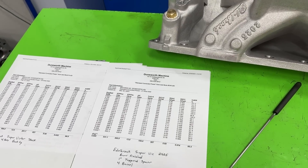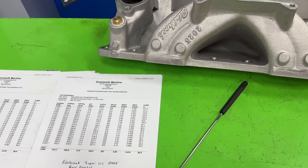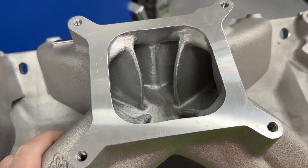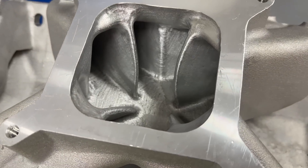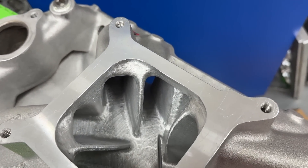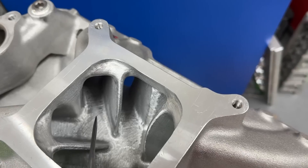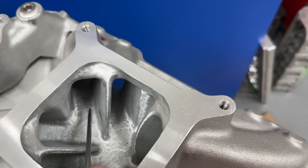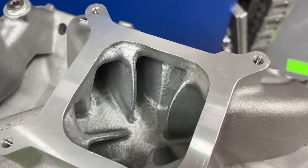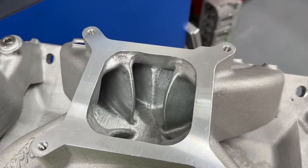During dyno session three last week, it was a last-minute thought: why not change the finish before pulling the heads off? So I did. This is exactly how it looks — I left the burr finish on the floor and 40-grit cross-buffed the dividers and through the top. Same cross-buff through the sides, so it's pretty smooth on the contours. 40-grit on the runners, really rough on the bottom. More of the surface finish is 40-grit or smoother than burr; the only really rough part is the floor.